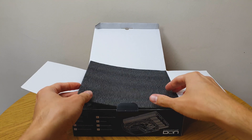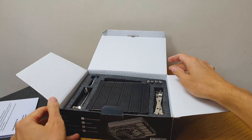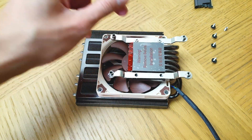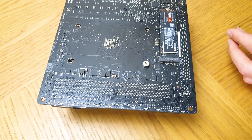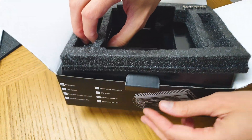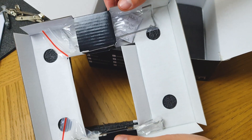In the box you get a nice display of all the necessary parts. It's very easy to install — just secure the corresponding side brackets for either AMD or Intel small sockets, then screw everything from the back of the motherboard. Not even a backplate is needed. It also comes with extra fan clips for either 15mm or 25mm thick 120mm fans.